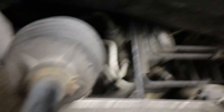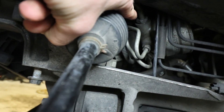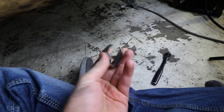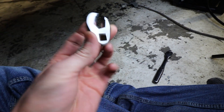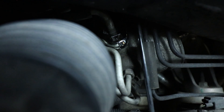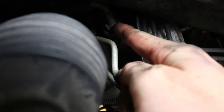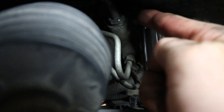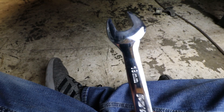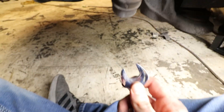And then we can get to removing the rack. We've got two cooler lines left. There's this top one and then there's another one right next to it. What I'll be using to get it out will be this crow foot — it's an 18. I definitely recommend getting one of these; it'll be a lot easier to get to. I got enough torque on it and broke it free. Now you can use your regular 18 to get it off. I just recommend using the crow foot so you don't round any of those edges, because that would be kind of a pain having to replace that whole line.